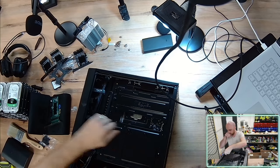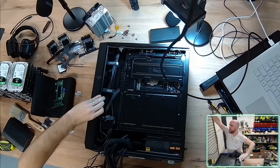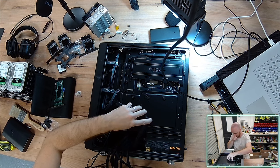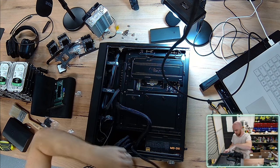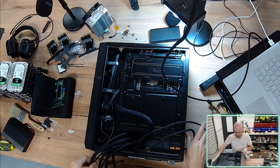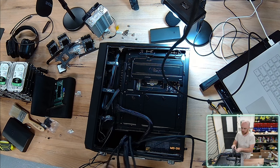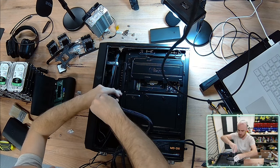Okay. Let's move this. So this particular provision here is going to land my motherboard cable right next to the motherboard socket that I need to plug it into, so we can route that there. This is my SATA power cables, for my build only for the hard drives. So I'll leave them to the side because I still need to have a think about what I'm going to do. This build's probably going to have an open side chassis. It's not going to have a closed case. So once I map the other critical components that are bound to the motherboard, bound to the inside of the case, once I get those cables routed, I'll consider what we can do with the SATA cables.